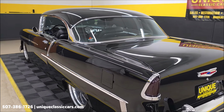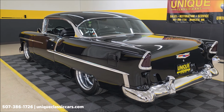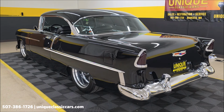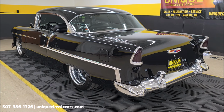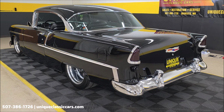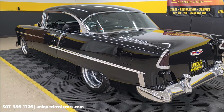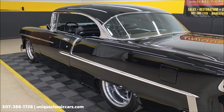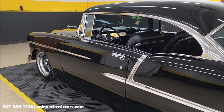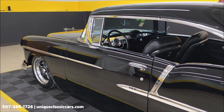All right, a little more about this driveline. Tremec T56 6-speed, close ratio with 2.66 first gear. ACT Street Twin with lightweight flywheel. Quick Performance 9-inch rear diff, 3.89 gears, axle tie downs and drain fill plugs. Eaton Wavetrac, 35 spline hardened axles, 1/2 inch by 2 inch screw-in wheel studs, custom 3.5-inch drive shaft with 1350 U-joints, billet yoke on trans and diff.